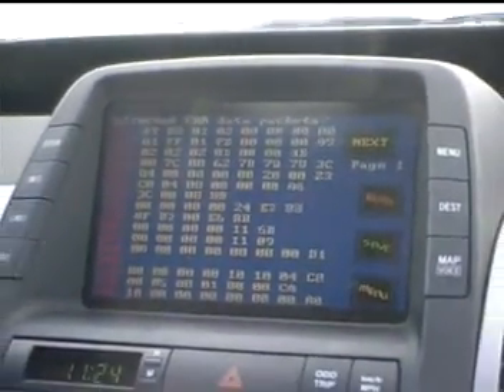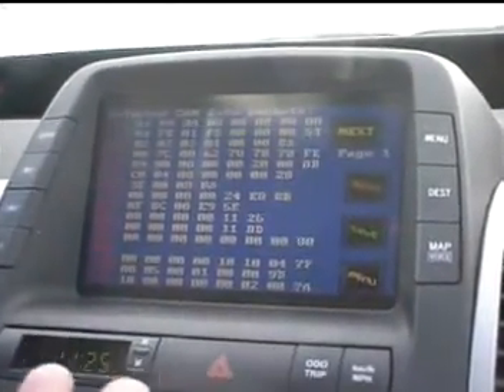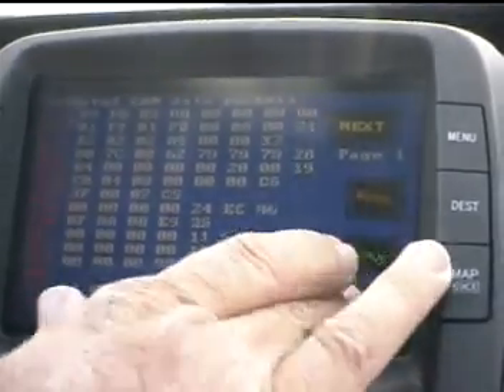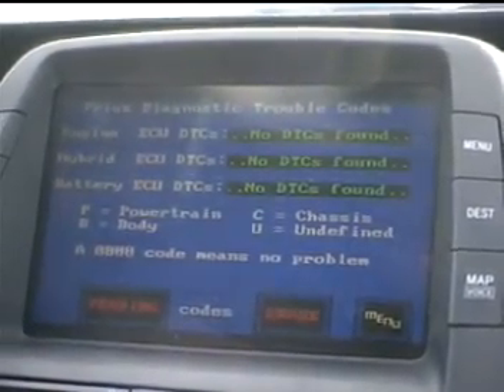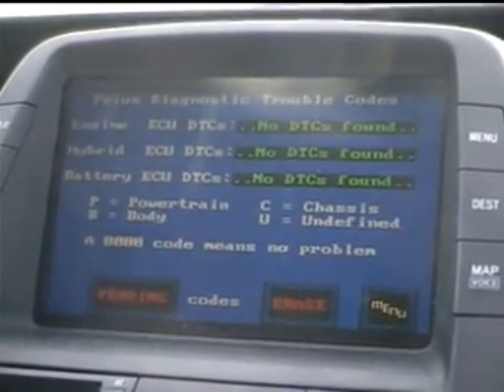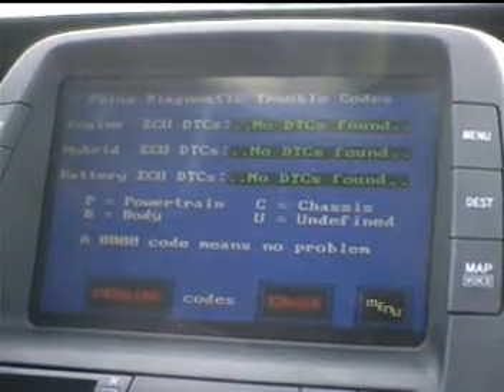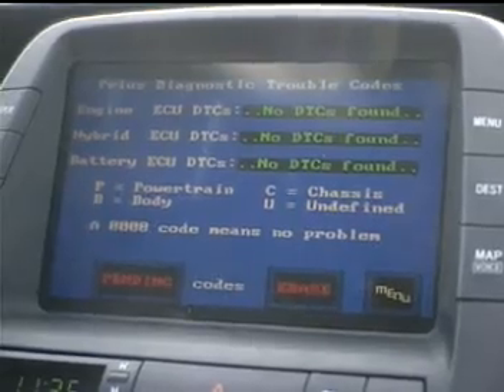There was a program modification needed for the computer because usually at 35 miles an hour it kicks on the engine. This is all the programming that goes with it — Calcars and others can give you the background on that. On screen there's an interesting one in the data package. The real interesting one is the last one, the DTC — the Diagnostic Trouble Codes — so that you can get readout from some 24 computers on board: readouts from the engine, the hybrid itself, and the battery. This is all computerized. This is what we call the CAN view, looking at the CAN bus and getting feedback from all these particular instruments.